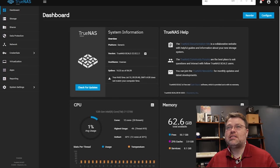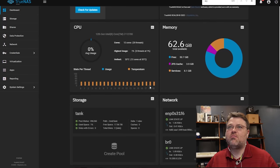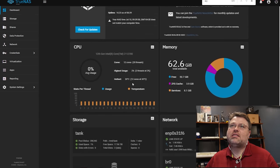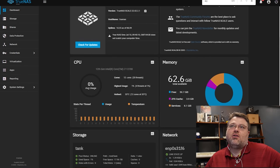When you first log into TrueNAS — this is the system we set up in the last video — I've got a dashboard with system information. I can see I've got 64 gigs of memory, the link state is up, everything's good. This is a really low-cost, very quiet home server: 35 watts, 20 terabytes of space, 12 cores, 20 threads. I'd optionally recommend the ZFS metadata special device. You can store a map of which files are stored where on the mechanical drives onto NVMe, and also store really small files there, which dramatically speeds up a lot of operations.